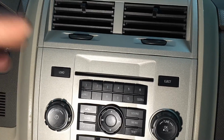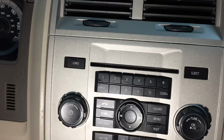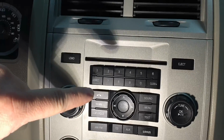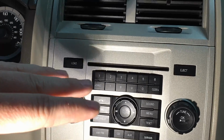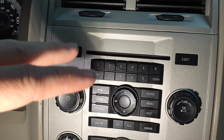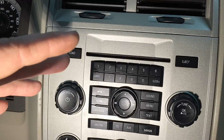One second you think you've got the temperature set just right, everything's fine, and then it just gets cold all of a sudden. It may also get stuck in the cold or hot position, depending on how bad that track is inside of there. If it cannot find position at all, it'll just stop where it's at and stay stuck until you reset it. So usually they click, like I said, back in the day, but the new ones just sit there and hunt. They may set a DTC, but you'll never know it.